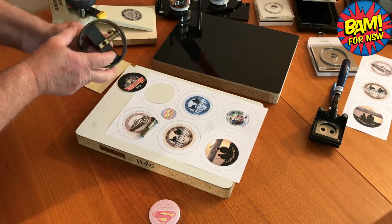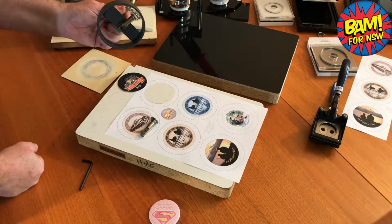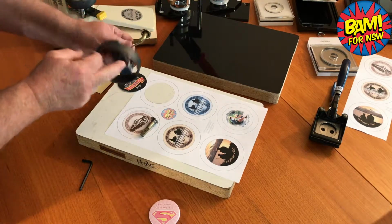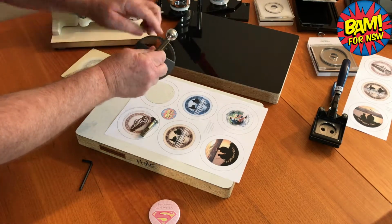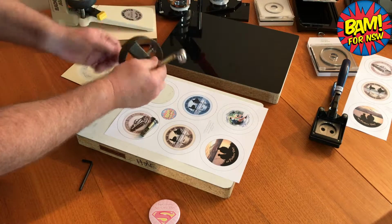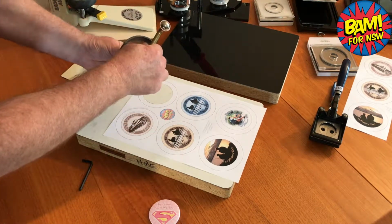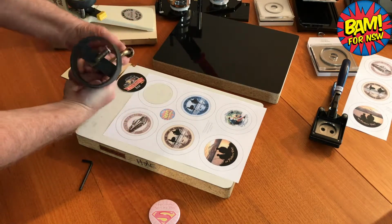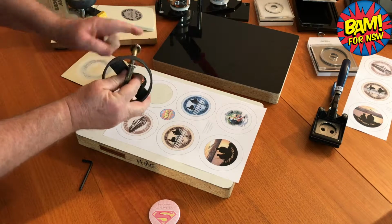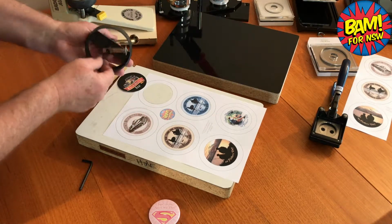Now, an important point to note there is, if you're changing your arm, it needs to be fitted the same way as this one is. And if you're looking through the circle, the handle is above the blade. If you undo it and put it on the opposite direction, it will lift off rather than push down. So it's important that it's put on in that same way, with the blade appearing underneath the handle, not on the opposite side of the circle.